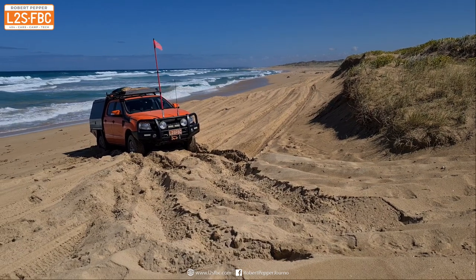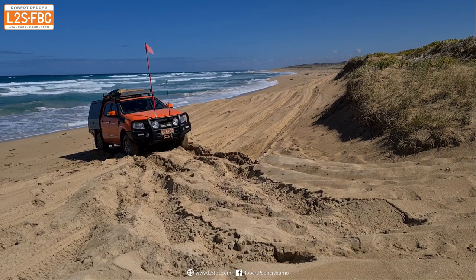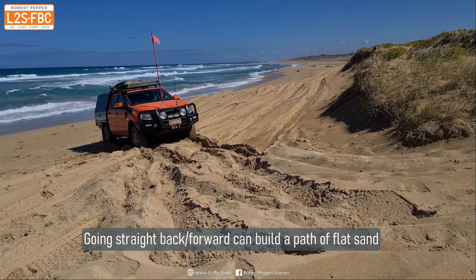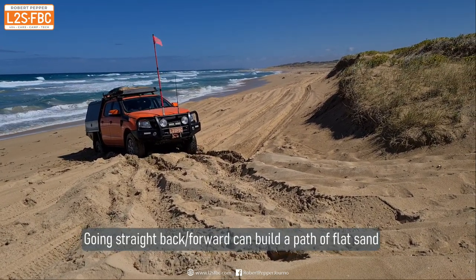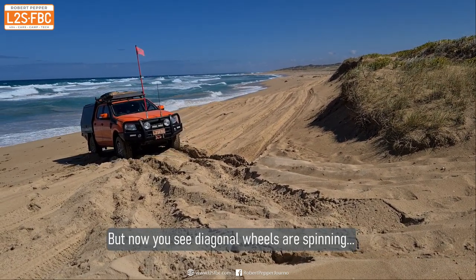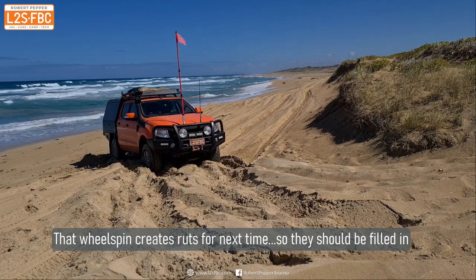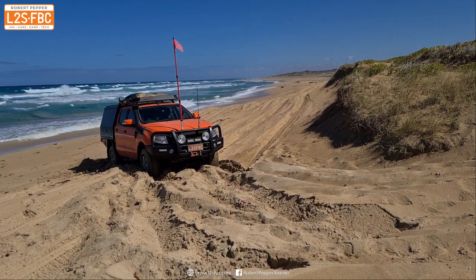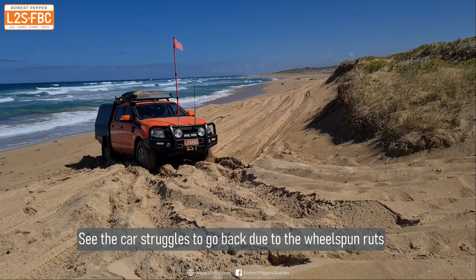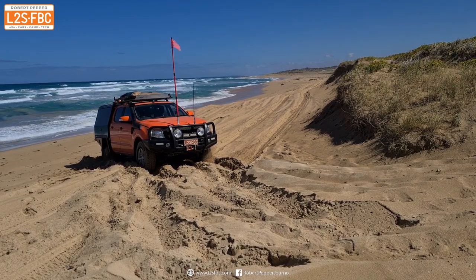I'm lined up and reversing back to give myself a bit of a runway, making sure the vehicle is dead straight — that bit is fine. However, going forwards I allow a bit too much wheel spin and the front left and rear right start to dig out, destabilizing the vehicle. When I come forwards again, I've got enough momentum to get over it but that robs me of forward momentum, and you can see the diagonal wheels are just digging in and the vehicle is physically going down.